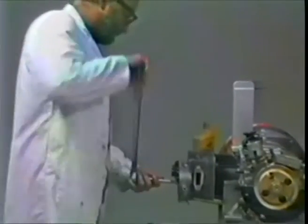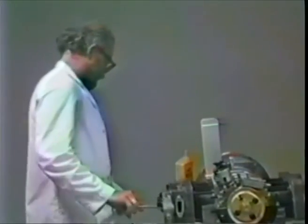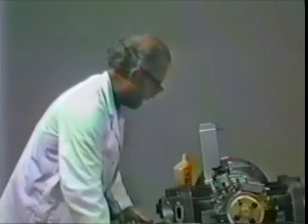like that. Once you reach 15 foot-pounds on this head, go over to the other head. This is the trick. Torque the other head down to 15 foot-pounds. There's going to be a lot of crossing back and forth here, but that can't be avoided. You get to do a little bit of walking around your engine stand when you do it this way.